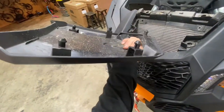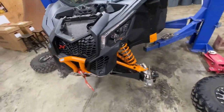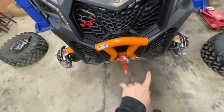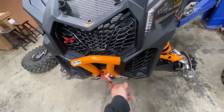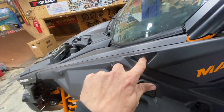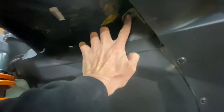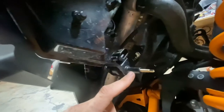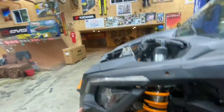To start lighting her up you've got to get her apart. To replace the grill you've got to take everything off, along with your accent lights. Take your front hood off - it's just little push-button rubber-style things that pop off. You've got two bolts here and a bolt on each side. It's a little hard to get around the bumper because the plastic is kind of molded to it, but it will come off. There's a bolt on each side, and a bolt and nut on each side - these are all T30s.